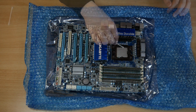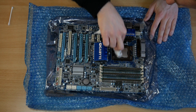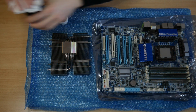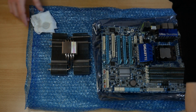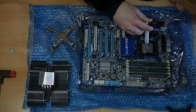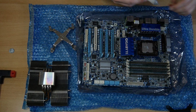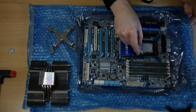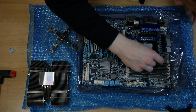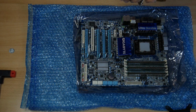Okay, let's get started with the build. The plan is to build the system without the storage disks first, and install the operating system. Then set up SSH so I can log into the file server without having to connect a keyboard, mouse or even a screen. The next step is to add all the storage drives and set up a ZFS pool. I'm using a RAID Z2 setup to get the double redundancy and only lose 2 out of the 6 TB capacity. Installing Samba is up next. Lastly, I only have to test everything and copy all my files over.